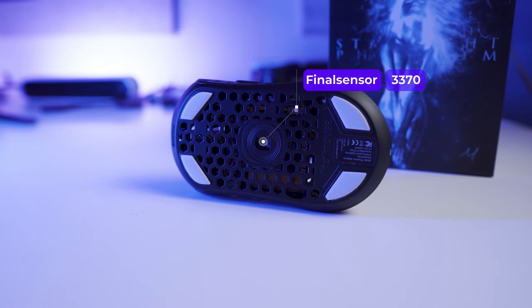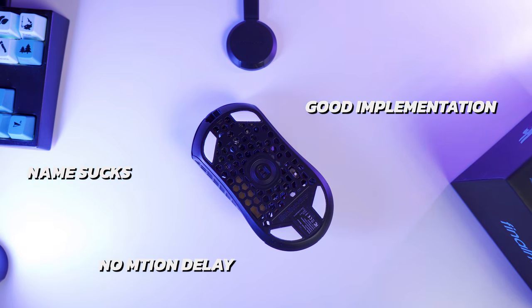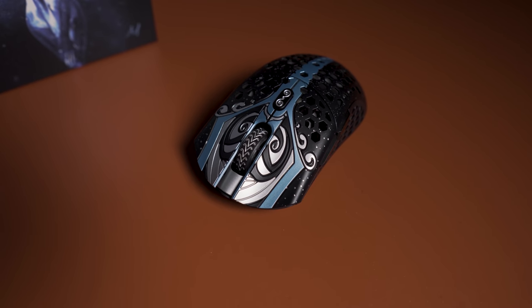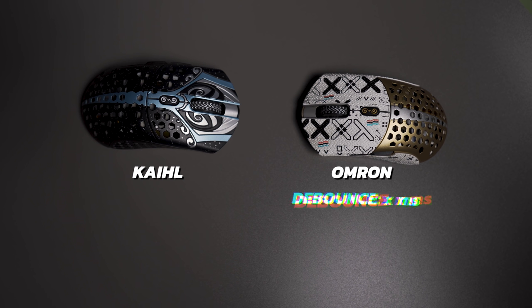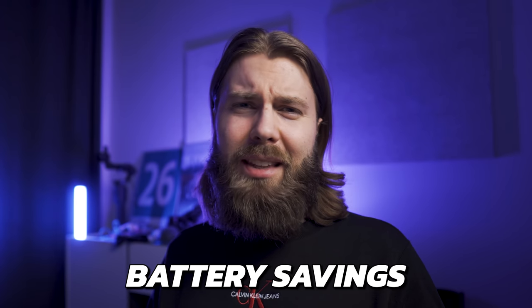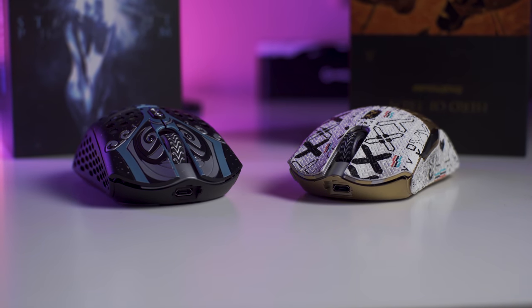Moving over to performance — let's start with the Final sensor. Even though the name sucks, the implementation is great: there is no perceivable motion delay, the polling rate is stable at 1000Hz, and the lift-off distance is under one DVD. So basically it's a very well performing mouse with no downside in sensor performance. For the click implementation, however, there are some issues. Final Mouse decided to go with the Kailh switches instead of Omrons for the Phantom, and it seems they decided to increase the debounce time instead of upping the voltage on the switches. Kailh switches do require a higher voltage than Omrons, but for reasons unknown — whether laziness, battery savings, or something else — Final Mouse didn't increase it. What this means is that there is more click delay on the Phantom than there is with the original ones.